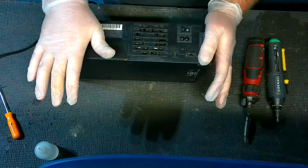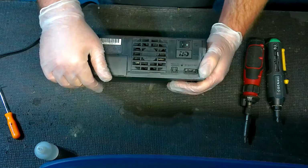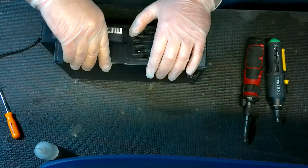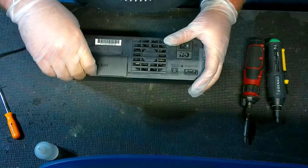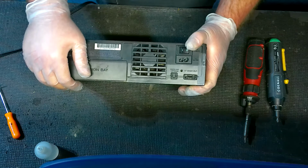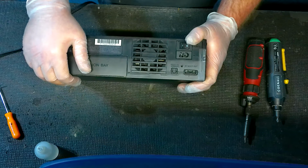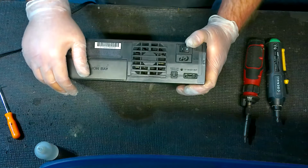Now, if you're at this point and you still have video issues, then unfortunately what we're going to be dealing with is a much more difficult problem. And usually, this is a hardware failure. The PS2 does have some IC problems where they will fail. Of course, a capacitor problem. That's an issue for any console this old in this day and age. So you're going to be dealing with a motherboard issue at that point.